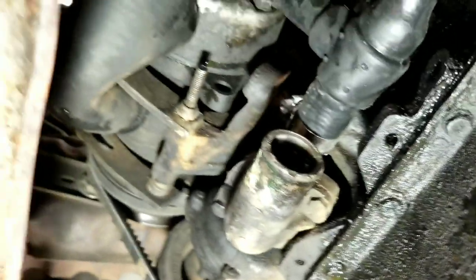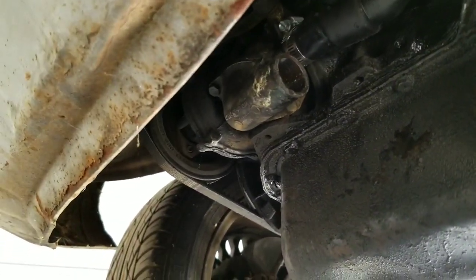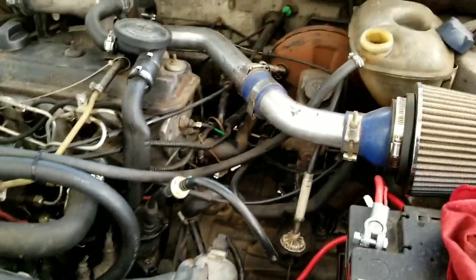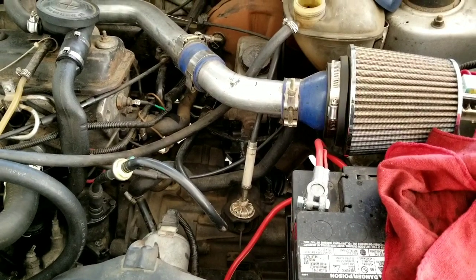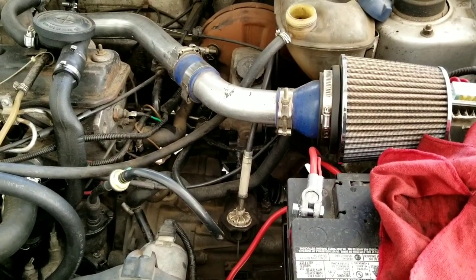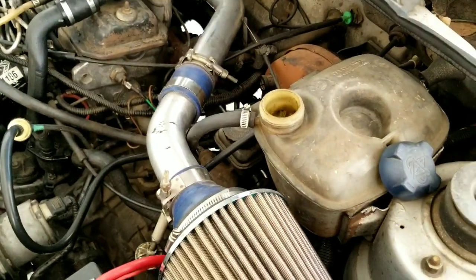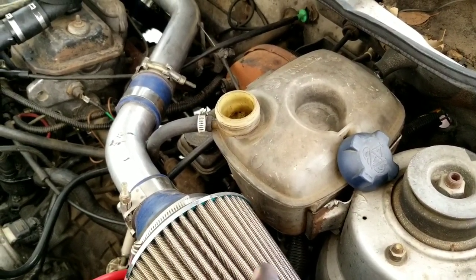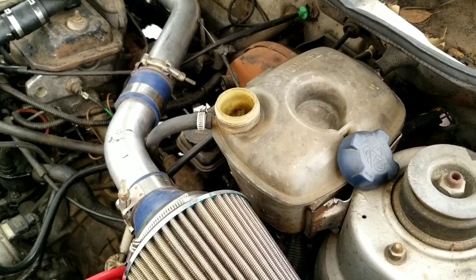Plan on changing them both if you're gonna do it. I now have to put on this lower radiator hose, which is the first thing you gotta take off to do the hoses. The clamp was in the coolant the whole time. I got the last one on there nice and good. When you fill your engine with coolant, make sure you use 50/50, or buy the coolant and add 50% distilled water. A reverse osmosis system works okay too — just make sure you have clean water with no alkali, and add 50% coolant and 50% water.